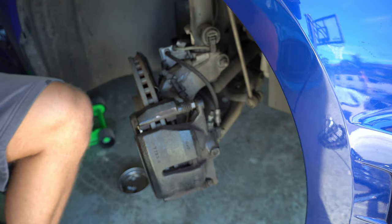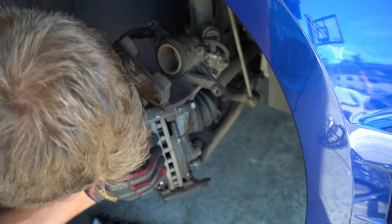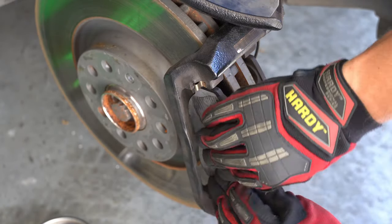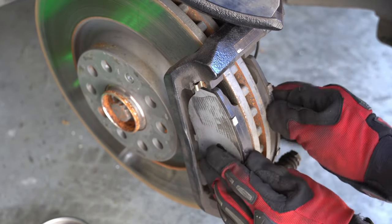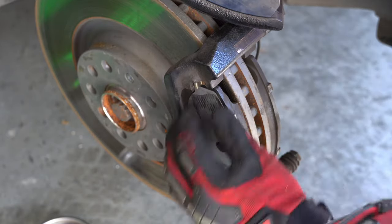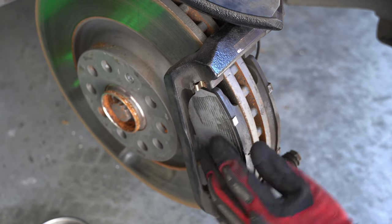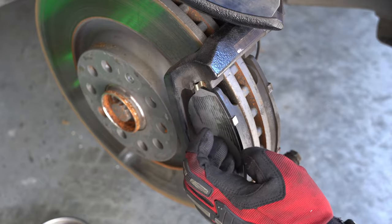In order to inspect the sound better, I removed the wheel and unscrewed the caliper using a wrench and socket at the same time to prevent the nut from spinning. Then the caliper just came right off. This is definitely the problem — there's way too much unnecessary play in these brake pads, which is so silly. So either I need to put something in there to shut it up, or put a lube on it. I think shoving something in there is going to be my only option.